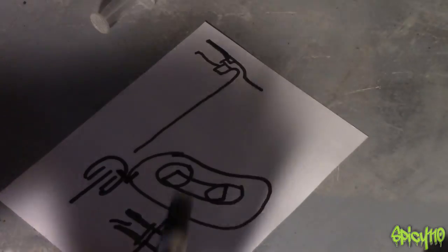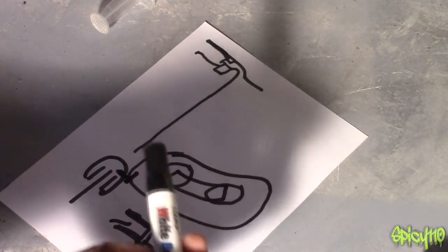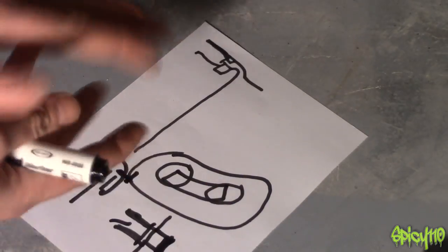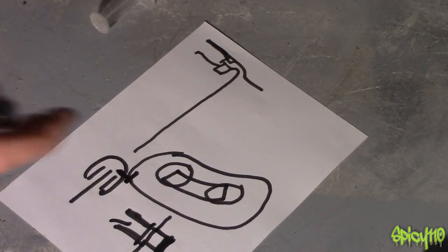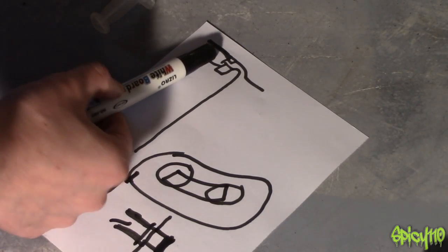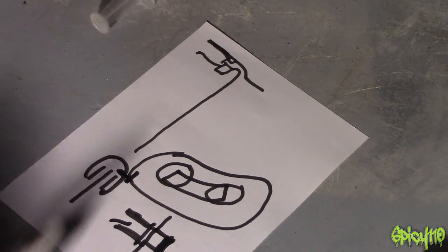That's exactly where you can uprate your brakes. If you don't feel your brakes are strong enough, you can change the master cylinder to one with a larger piston, which pushes more fluid and gives you more force upon your caliper. But they do need to match within reason — I don't think you should put a really high-end master cylinder on a really low-end caliper. There needs to be some sort of middle ground.